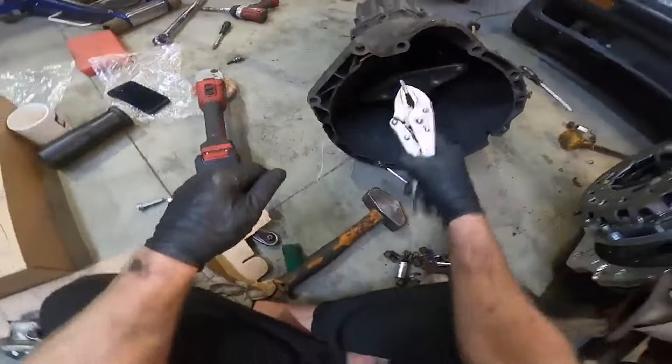Now the car was driving, we needed to start getting it looking presentable. We had a full wide body kit and installed it — another super messy job I wouldn't recommend. I actually had to do it twice because the first time I didn't cut it high enough and it was going to hit the new wheels. I wanted the car under a thousand kilos, so we installed a Kevlar roof, fibreglass bonnet, and fibreglass bumper. We also got a full set of custom coilovers made by Gaz Shox with two-way adjustability, sent to Wizards of Lock for a full lock kit, with custom arms and modified hubs for angle.